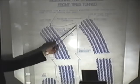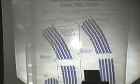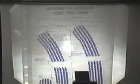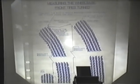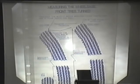And in some cases, this one might be right on. This one might be a little shorter or a little longer, depending on the steering mechanism of the vehicle in question. I found you don't always get consistent results, depending on the vehicle and the way the front end is set up. So we'll take an average and we'll get an approximate wheelbase. Under good conditions where you can see where the tires have stopped, you'll probably be within 2 inches, plus or minus 2 inches. When we do a search with the computer, we always go plus or minus 2 inches on the wheelbase. We don't go right on.